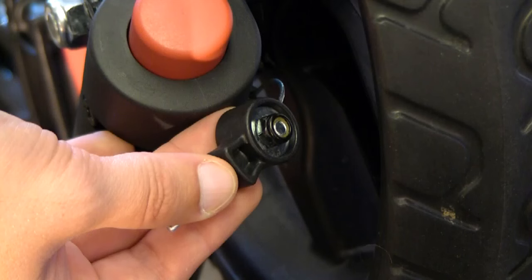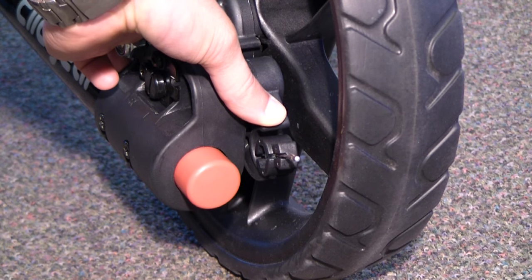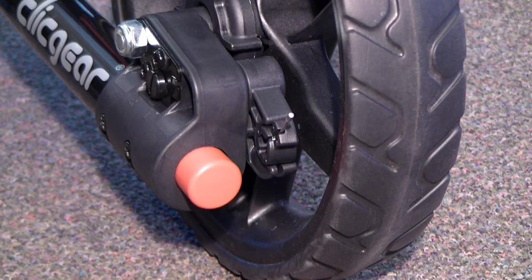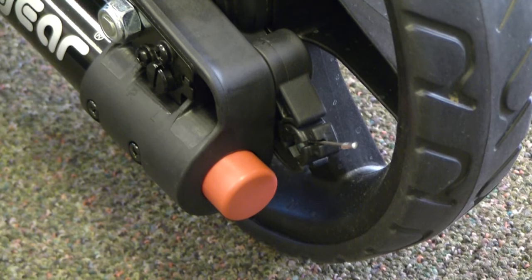This should have the small nut facing the wheel. Now slowly release the brake hammer until the cable nut assembly and brake hammer touch. This should do it. Test the brake and see if it's functional.